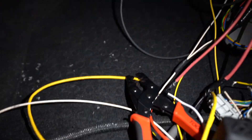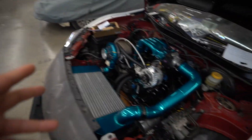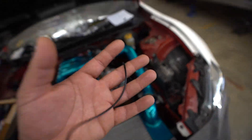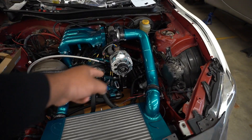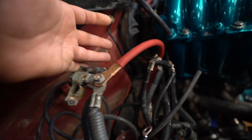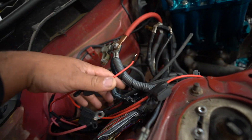Once I clean that up, it'll be technically finalized. The fans are mounted in their correct spots and I ran the wiring for those. I finished up the wiring and finalized everything for the starter except this wire, because I need to order a button. Since we're not running the bracket or AC anymore, I talked to JDL and I'll be able to exchange the side-mount AC and alternator mount for just the alternator mount. I've got all my wires run, fuses and relays are good.